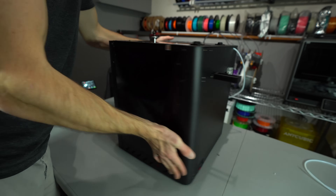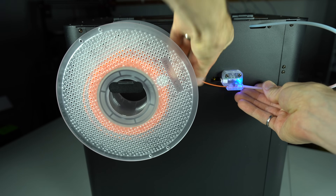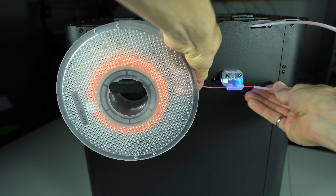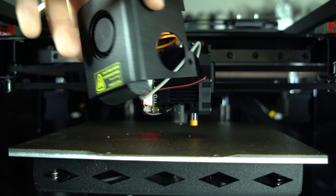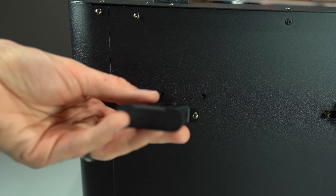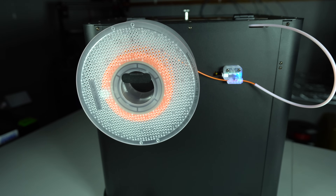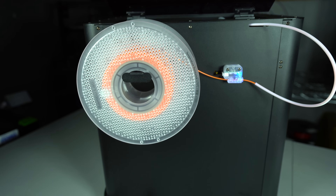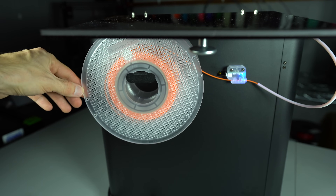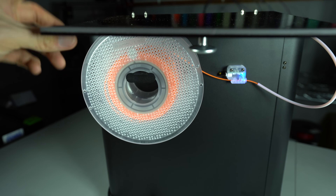The KLP1 is a nice little printer, but it's not perfect. Here are my complaints. Filament feeding is somewhat inconvenient, with the filament often getting stuck on the way to the toolhead. On one occasion it managed to escape the drive gears entirely, requiring disassembly to recover it. The spool holder location is poorly thought out, being placed too close to the top of the machine. This results in the top door resting on the flange of the spool when open, which causes filament feeding issues. The top could easily be propped up to avoid this, but I'd rather the spool holder just be positioned lower.